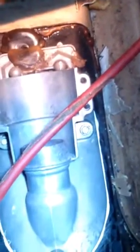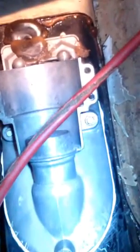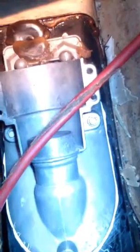Alright, so now I'm going to put my new shaft back in place. But what I'm going to do is I'm going to put a little RTV on this right here, this right here, all the way around. I'm going to actually put it on that little rubber coupling, before I slide the shaft in and tighten those clamps, because I don't want the water leaking around that anymore. Hopefully the RTV will slow it down, but probably don't need it as long as you clean it up good, but I'm going to put it on anyway. I don't think it'll hurt.